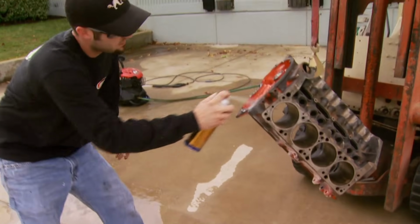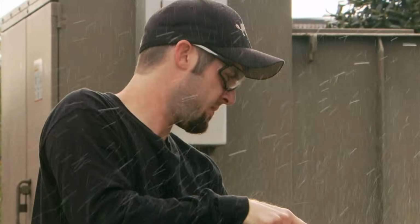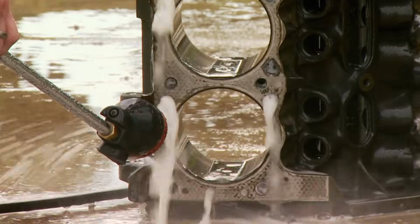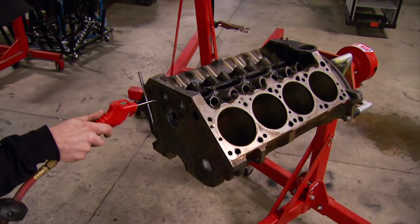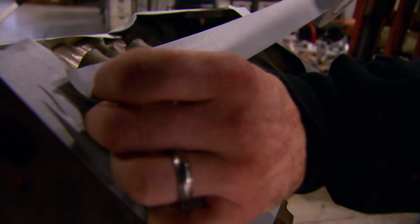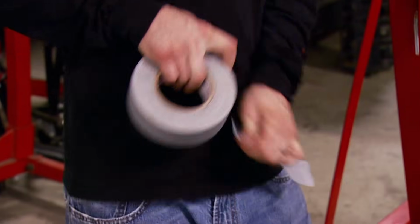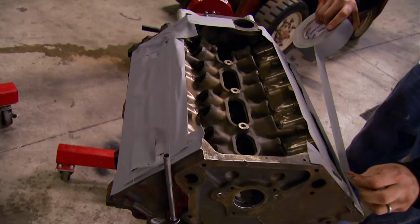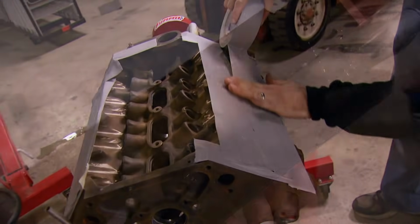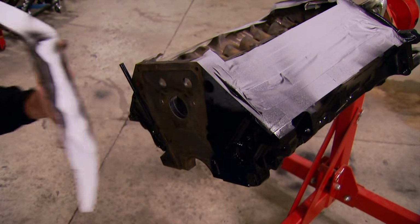While the grease and grime is gone, there's still stubborn old paint on the block. Now here's where we need a coat of Duplicolor stripper, a good old pressure washer, and a partner willing to do the work. With the block totally clean and bare, a little compressed air helps to speed up the drying process. Now there's a race against rust, so no time to waste, masking off the head mating surfaces and all the openings. Then a couple coats of Duplicolor engine enamel, which dries quickly.